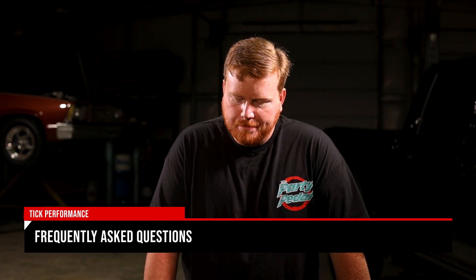A commonly asked question from fans on social media is whether this is stable enough for certain components. The only thing I would say is keep the load rating in mind - three amps, don't go over that. If you're using it as an activation input for your ECU it's not even going to see one amp, so yes it's fine. As long as you're using it as an activation and not the actual power source it's just fine, and it would be reliable for things like a parachute signal as long as you're within the load capacity.